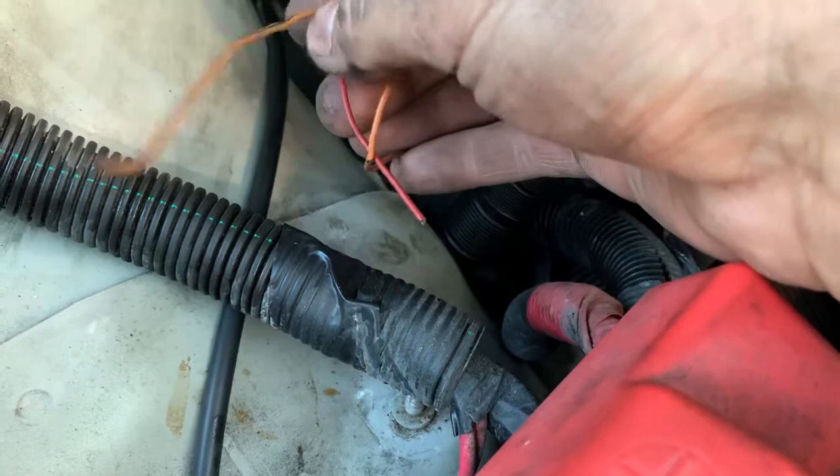It's kind of strange that whatever did this chose all three wires like this — it chewed through them. So I'm going to have to repair these three wires and hook them back up to the connector. I have some heat-shrink butt connectors for that. There was also another thing I noticed underneath — look at that wiring down there. Whatever did this caused a lot of havoc in this car, so I'm going to have to go through and fix a lot of wiring.